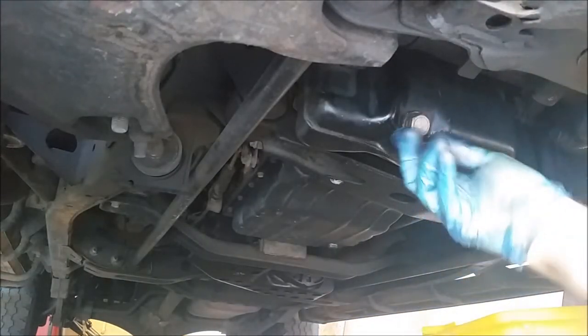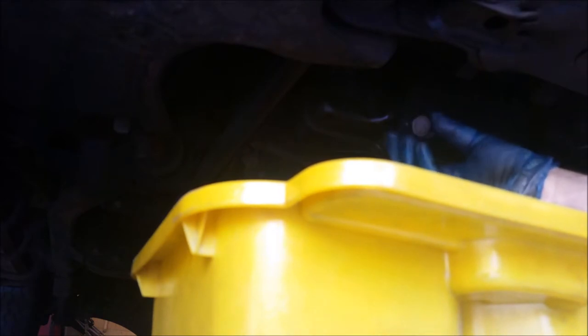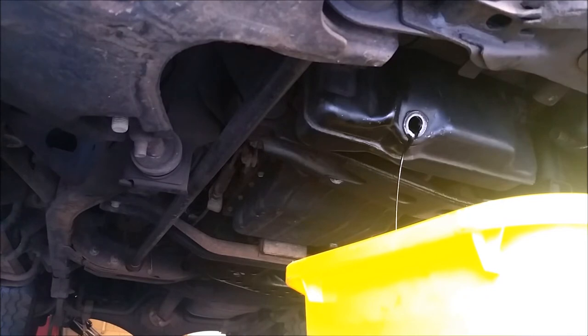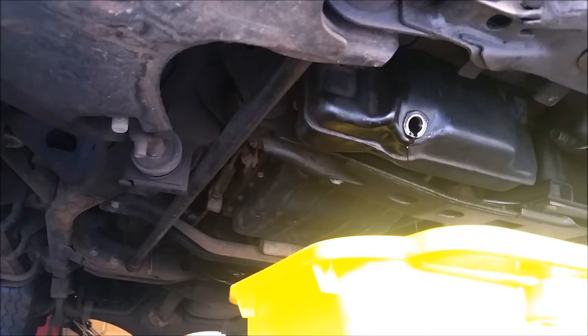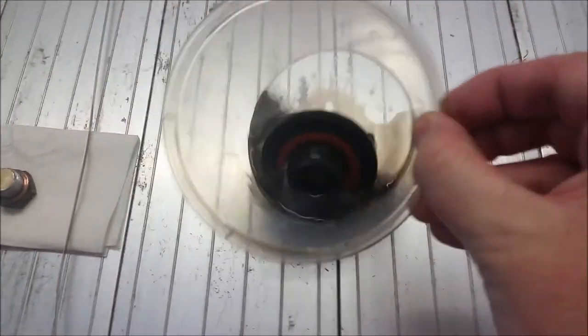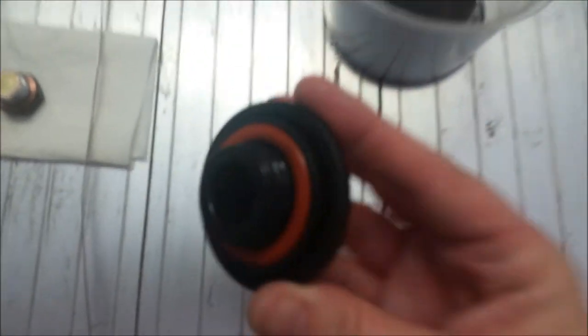That was on tight. Old drain pan underneath. It would be a really good idea to put your drain plug — nice and clean drain plug — where you can find it so that it won't get lost, also just next to the dipstick, which is a good idea. And also your oil filler cap, which I'll give a clean off right now. There we go — absolutely spotless. So we'll put those two there.